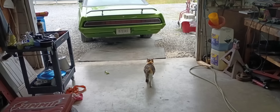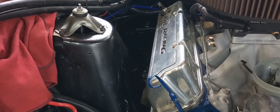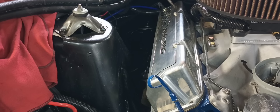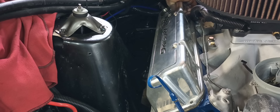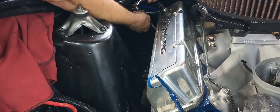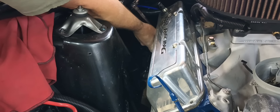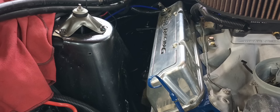It's the next day and Daisy is doing cat things again, just making sure everything's all right. I got like 12 days at this point so I better get busy because I got a pile of parts that need to get on the car. A lot of you may be wondering why the valve cover's back off - it's because I was waiting on parts. I ordered a new set of rocker arms, set of push rods, and some valve cover studs because these bolts are too short. We'll get those put on there so I can get the heater hoses buttoned up and get the distributor dropped in.